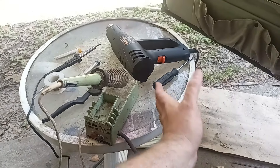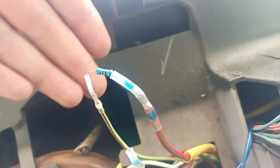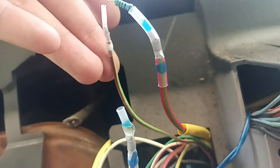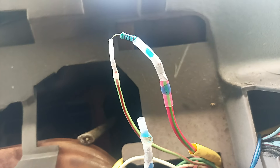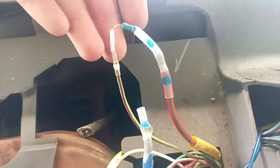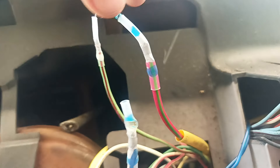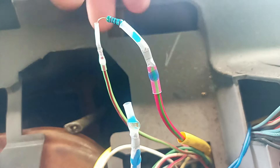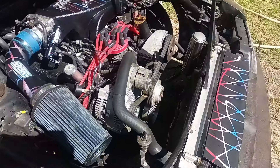Two solder guns down — I don't know what's going on, couldn't get it to work over here, so I just put the heat shrink connectors on there. It's got solder in it so I made sure it was melted. Here it is going from pin 14 to pin 2 — I just jumped it with this. I'm going to let it cool and then slide the heat shrink over it for coverage because it's bare right there. That's the 500 ohm resistor done.